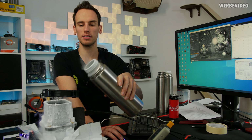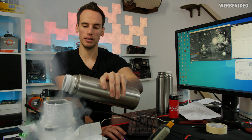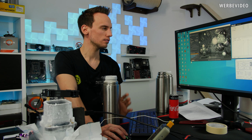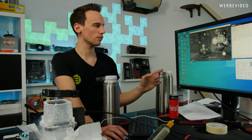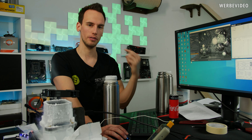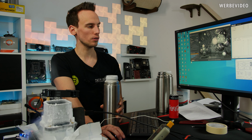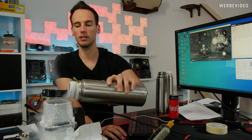The previous world record was with a 10900X, which is Socket 2066, Cascade Lake X, running at about just above 6 GHz as far as I can remember, and the score was 34-10, roughly. We're now running 34-68, so we already beat the previous world record on 10-core Cinebench R15, running 6.5 on the core and 6.2 GHz on the cache.